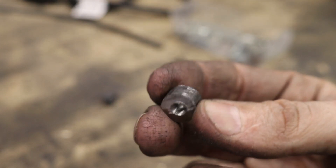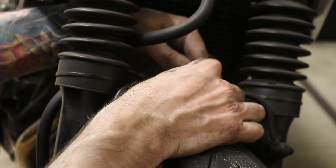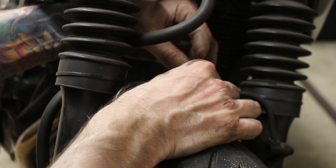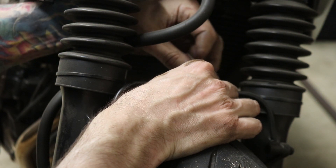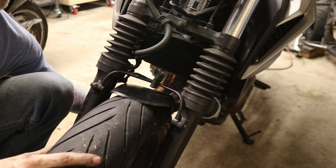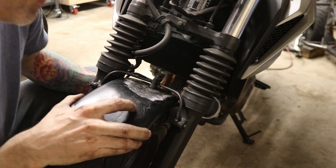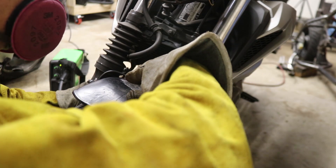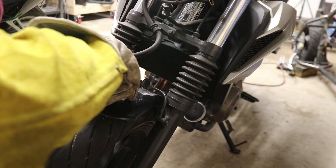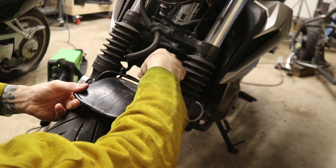Let's go to the bike. I've got a bolt to go along with my new nut, and I'm going to screw these things on here to hold the nut in place where it needs to be. Then I'm going to come through and weld the fender onto the bottom. Now we've got the fender — roll this thing up here, put it where I want it to be, and I'm going to tack that on. I've got a couple tacks in — I'll take this off and weld it up more fully.